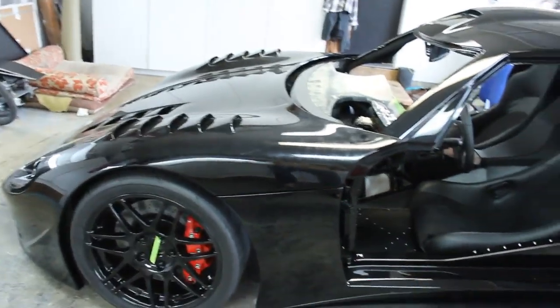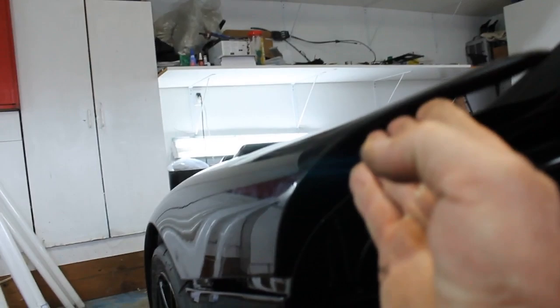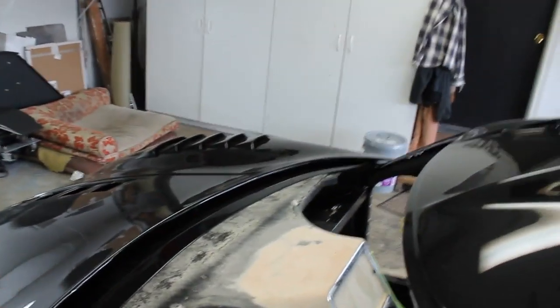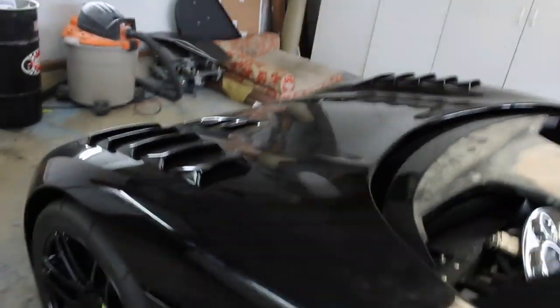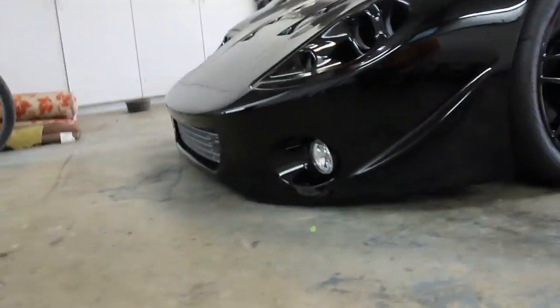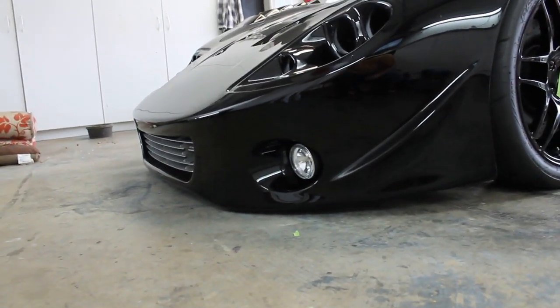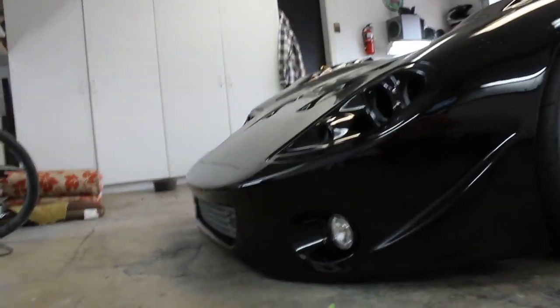So yeah, that's all latched down. And remember, I put little rubber snubbers under here, which are adjustable. Same thing in the center. So it's all solid, won't be vibrating going over the bumps. And stuck the road lights in there. If I had the splitter on there, I wouldn't have been able to jack the back end up that high. It would have been hitting way before that.